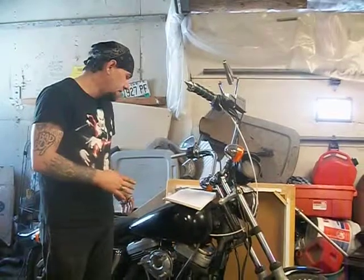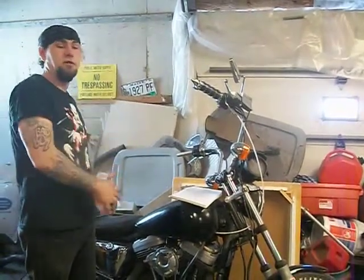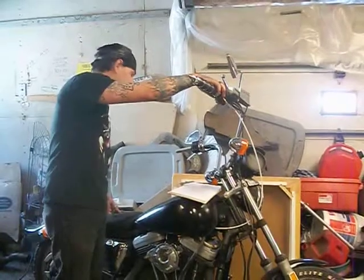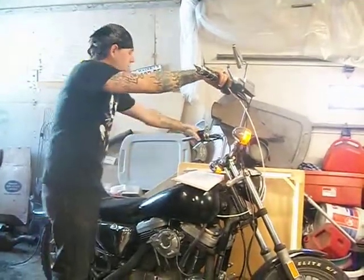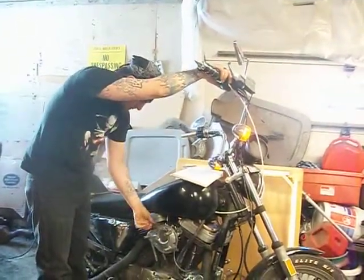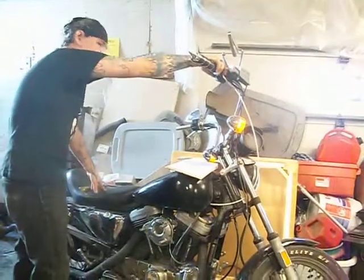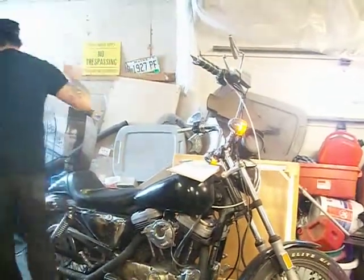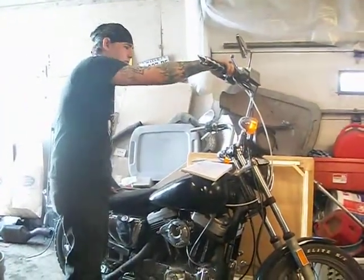I just wanted to show you guys that the bike does run. Everything I did last night, all I did was hooked it up. I haven't messed with anything, so I'm going to show you it running. Switch on, switch down here on, and I'm going to put the choke at quarter — that should be enough. I like to prime mine two times on the throttle. One more thing: open the door — do not start your bike in a closed garage. Think smart, people, and hit the start button.